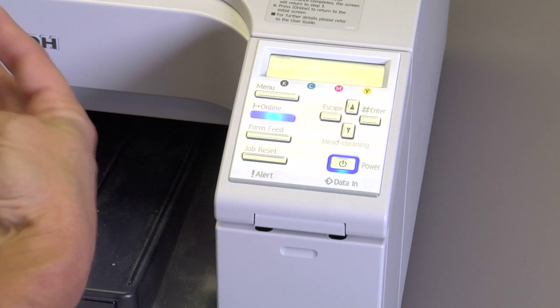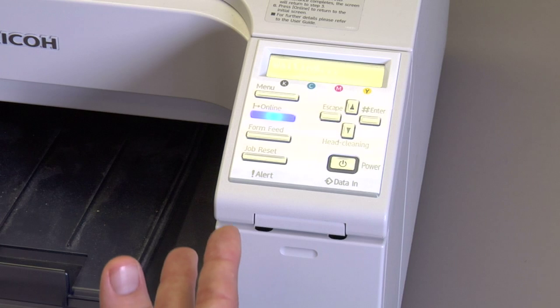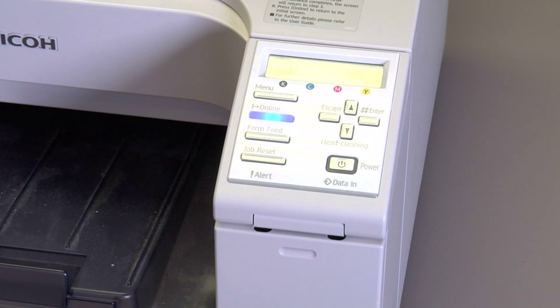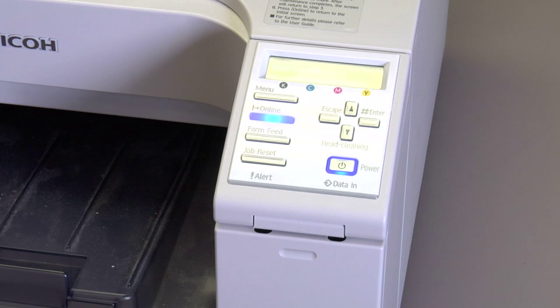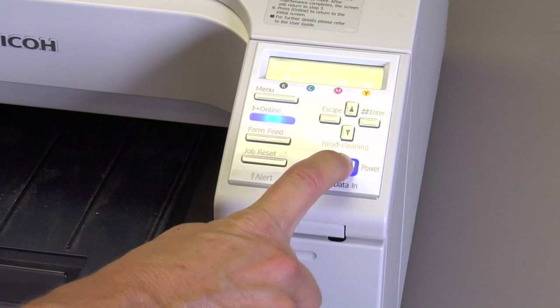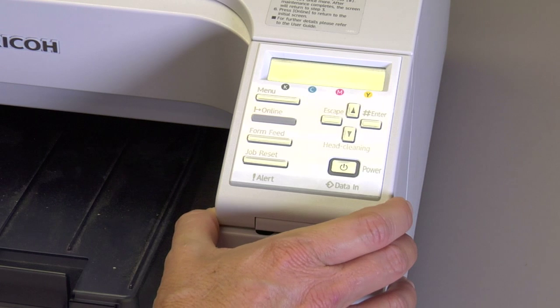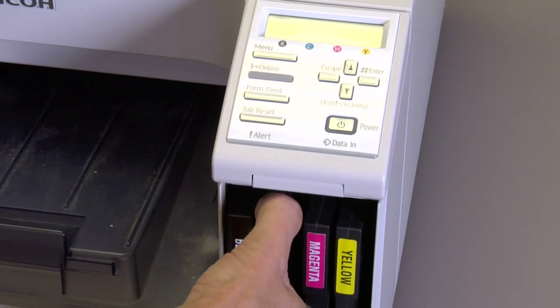You'll do this four times unless the 990 error has gone away. If you turn it back on and the 990 error has gone away, then we've solved the issue. If not, then you'll move to the cyan, and then the black, shutting the printer off in between and turning it back on, which primes the line each time. In addition, if those four times don't work, then you can continue to turn the power off and back on without taking the cartridges out three more times, which would prime the line three more times.